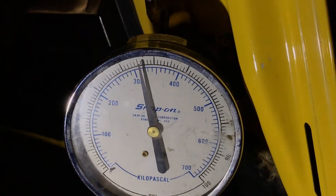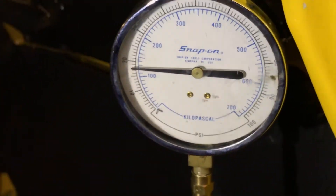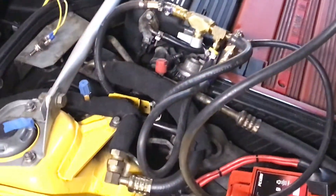We're going to give the fuel pump some juice by flipping our switch on. It looks like we're getting to about 46 psi, which is about three bar. I've shut it off — you don't want to run for more than about 10 seconds; three or four seconds is a nice run because you don't want to back up the fuel system too much or risk overheating anything. What we just tested was the internal valve of the regulator. On this Evo 2 16-valve engine it should be a three-bar regulator, and we are hitting three bar. The regulator takes fuel off the rail post-injectors and has a valve that prevents fuel from back-feeding through the return line to the tank until it hits a certain pressure.